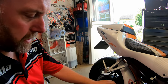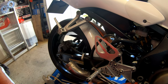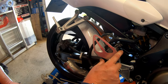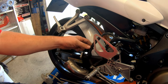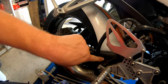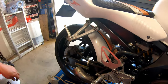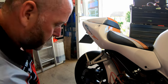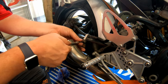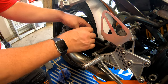Here we are at the rear caliper. You may notice something odd because the line doesn't look right. The reason is this bike has aftermarket Harris rear sets, which are a damn sight further back than normal - this peg would normally be around about here. The master cylinder is mounted differently, so consequently it looks like there's a much longer hose than there needs to be. One of these brackets here has been removed because it's not really doing anything with this setup. Moving on, we need to remove this line. I'll start here with the hose bracket. I've removed the exhaust because it gives us plenty of access - it's just a slip-on anyway, so it was pretty easy.